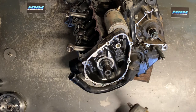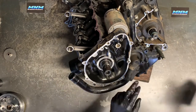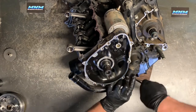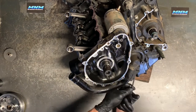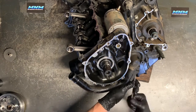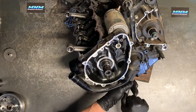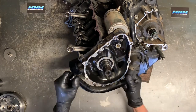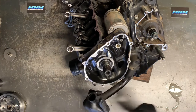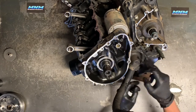Next we're going over to the water pump. We've got the impeller under this cover. There's an eight millimeter bolt and an allen bolt — I believe it's a five millimeter allen — that we need to remove. That allows us to turn this tube to access the eight millimeter bolt to remove the impeller cover. This water line goes up to the cylinder head, this one goes to the radiator. We'll remove that coolant line and turn it to access the remaining bolt. Got that eight millimeter removed — there were actually two more already removed.